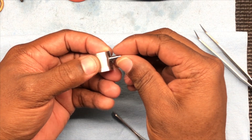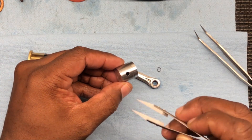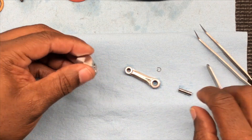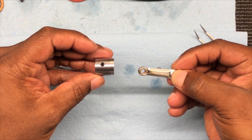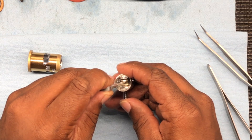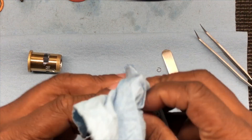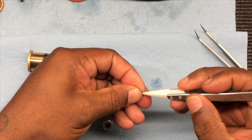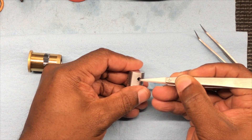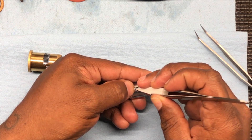That way when we put this one in, we want it to slide across and then hit up against that one like that. See how I put that pin in there — it slides across and hits that. That's what we want. Remember, this is the exhaust side — we want the reds like that in there. Get everything lined up so it goes right in there just like that. Make sure this is pushed down enough. Same deal with this clip — get it positioned, put your finger over that hole. Get it in the groove, put your finger on that thing and push it down. See that? Snap right into place.